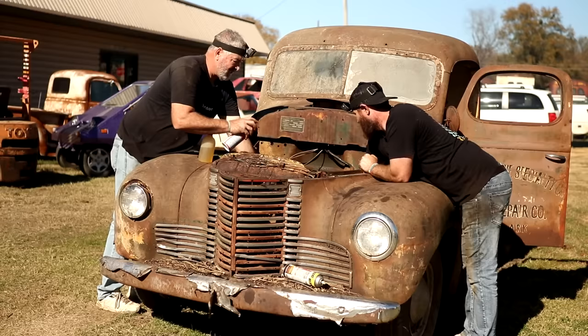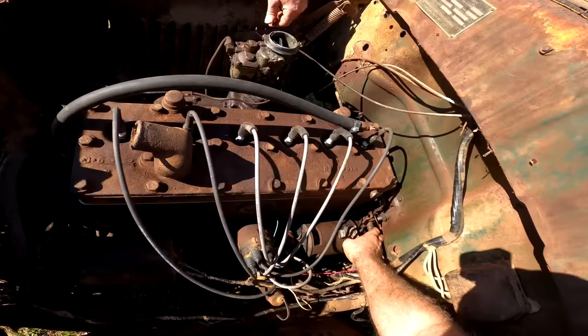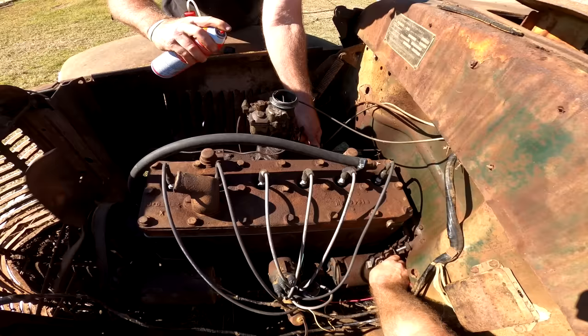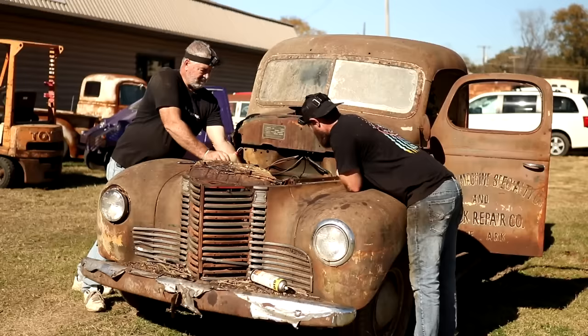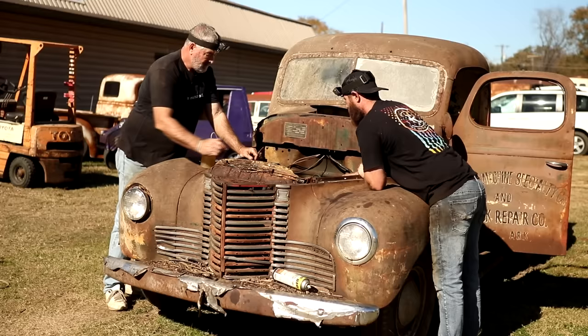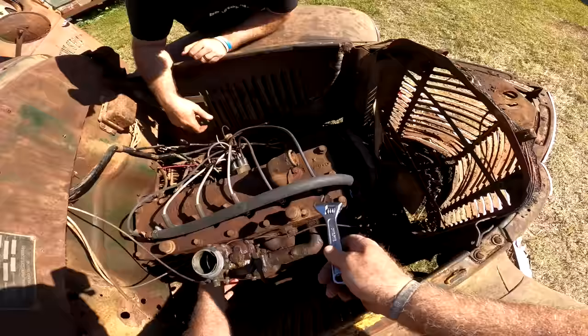Hit it too soon. I may have to start cranking it inside. The starter wires get a little warm. Hang on just a second. I felt something hot, I thought. All right, ready? Yep. Pumping anything yet? Not yet. We're gonna have to get that carburetor squirting. Bet that float's just stuck down. Let's try it one more time and then we'll pull that carburetor off and see what's going on in it.